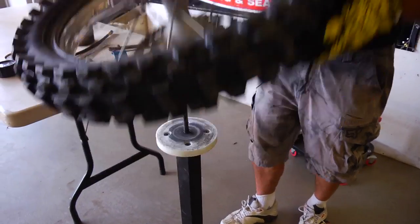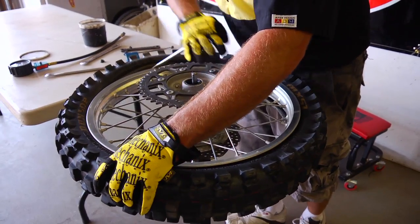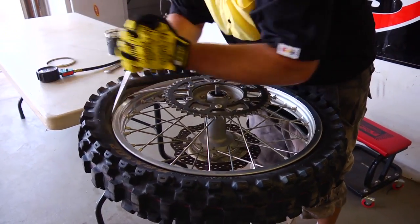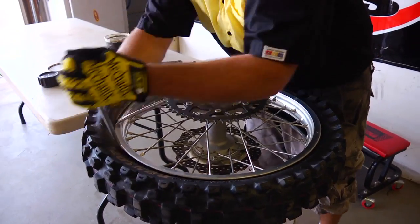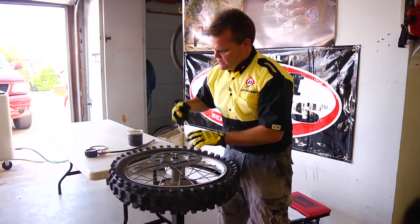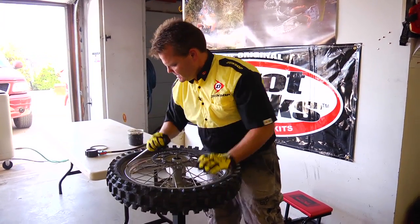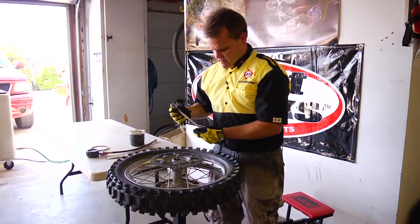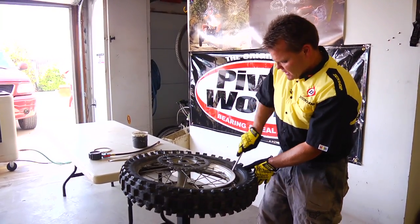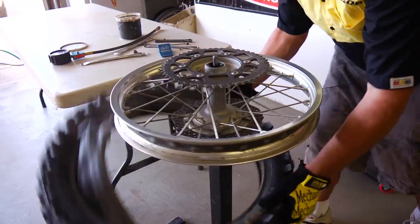Now in the old days we used to pull the tube out. Some guys do that, but I just find it's easier to pull the tire off from the other side. So we're going to do the same thing we just did — going right under the sprocket, inch and a half to two inches apart on our bites, popping those out. Now our tire's all the way off. It's easy to go right next to the rim lock, just pull the tire down — comes all the way off.